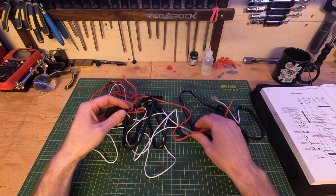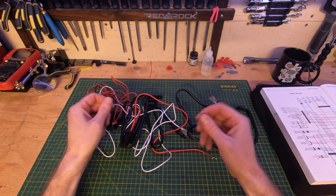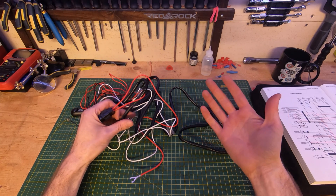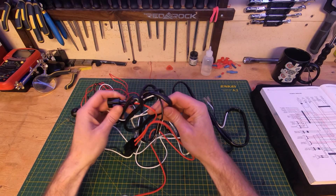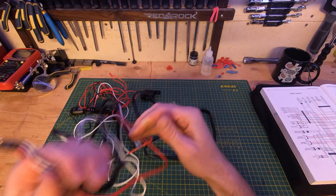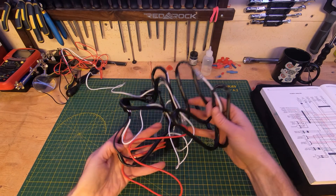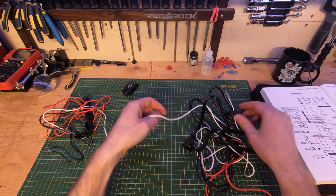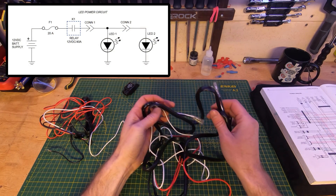This is the two-LED wiring harness. You can buy these from Canadian Tire, Princess Auto, or Harbor Freight — search for 'auxiliary light wiring harness' and look for the one that says two LED. Within all of this, there are really two circuits. The LEDs are powered off the thicker wire — they take their power directly from the battery. This section comes with two little fork connector things that go on the battery.